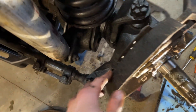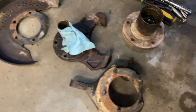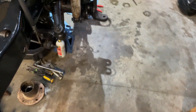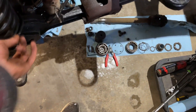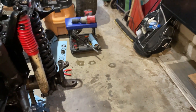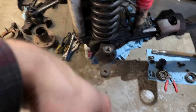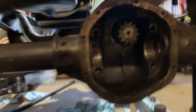This stuff is pretty simple - lube these up, break them loose, pop the spindle out, and then the axle comes out. Get the brake seal off and it's fully stripped, just like the other side. All my tie rod ends needed to be cut because they were all destroyed - they're all getting replaced anyway. We need to clean out that dirt, which is why I'm taking both axles out. We're going to stick a piece of wood with a towel through there and really clean it up on both sides.